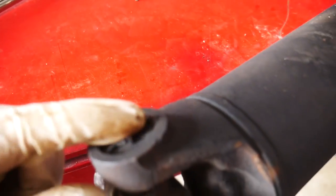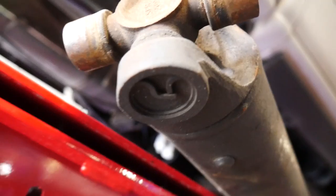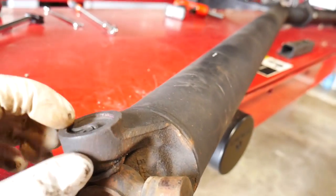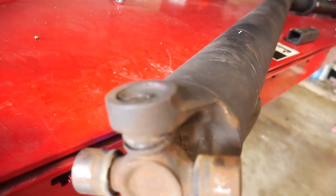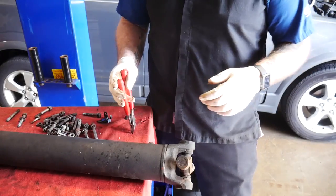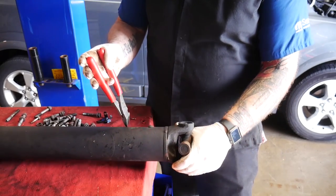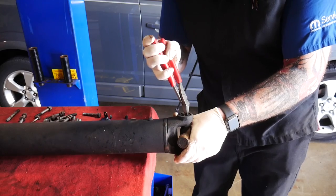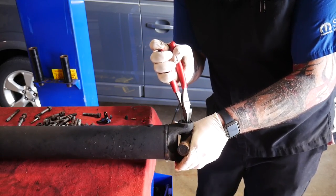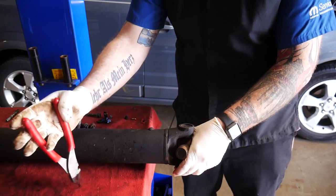What we're going to do now is get this out. We've got a couple of clips on either end, and we're going to get a pair of side cuts to pinch and get those clips out of here to start off. This end is going to be pretty easy because we don't have a yoke on this side. I just usually use a standard pair of snips — squeeze the locks together, give it a little twist back and forth to break it free, and then there's our retainer clip.